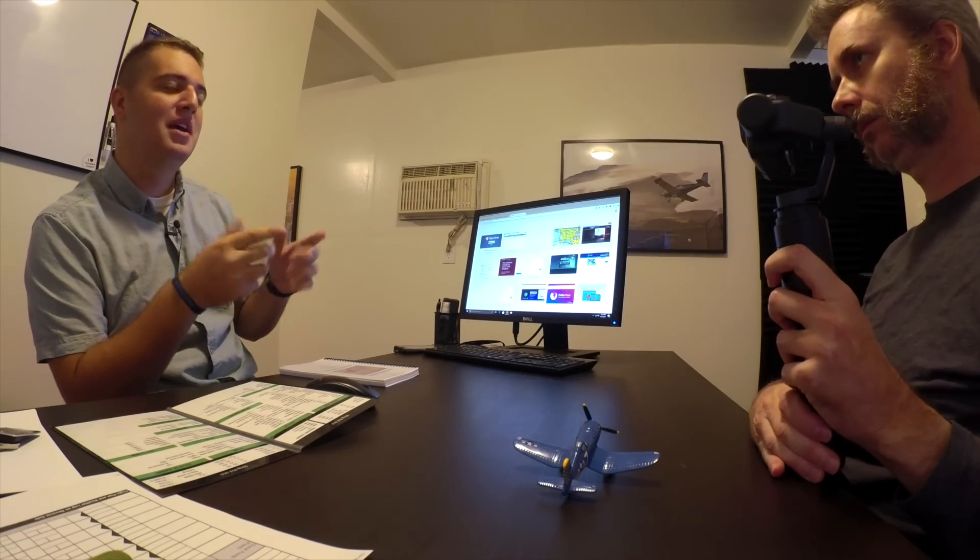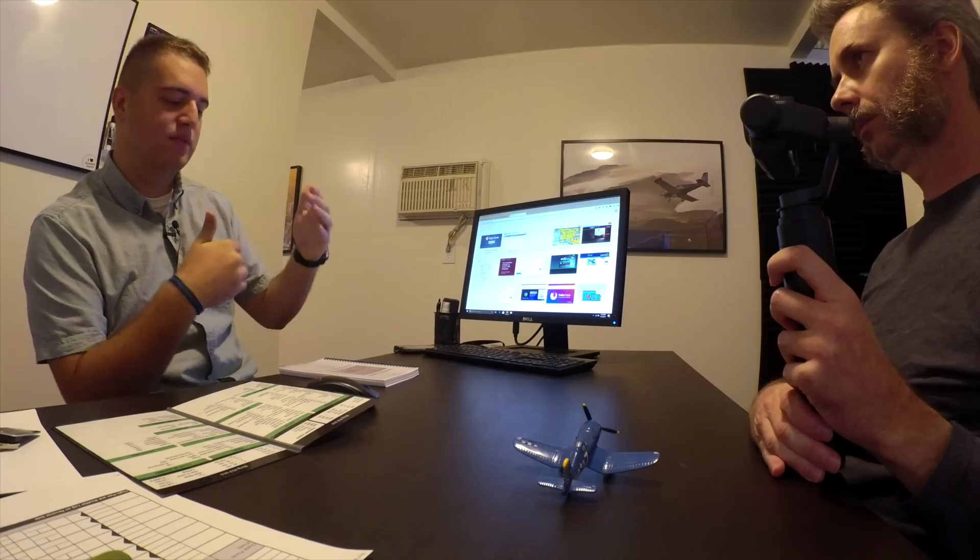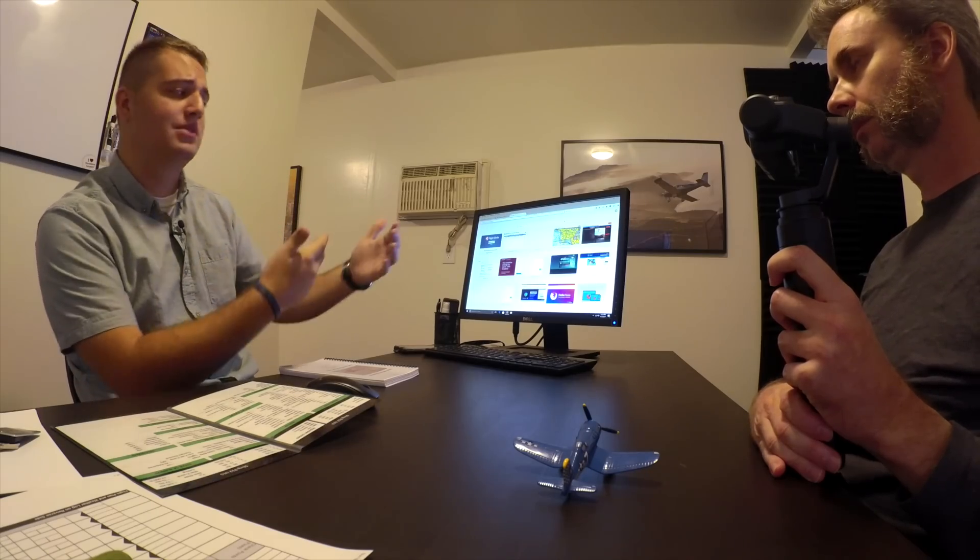That's so weird — but it's a lot easier to get used to than you might think, because instead of going from 500 to 2500, you're going from 2500 to 5000. Once you get your head around that, you're going to see really high RPM settings. On takeoff you'll see 5400 RPM, but the prop is not spinning at 5400 — there's a reduction gear, so it goes from the engine to the gearbox and then to the prop.